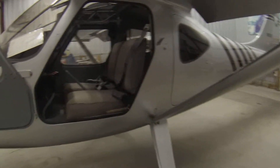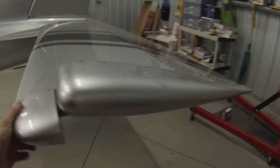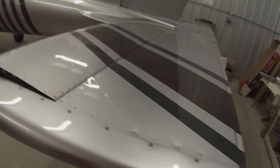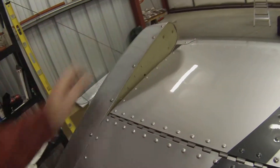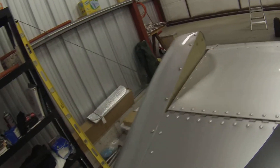The first step is to put down the flaps, and then I usually start back by the baggage door, just make sure everything looks good there, work my way down to the tail, make sure everything looks normal — no bird strikes or anything like that, no wrinkles in the skins on the tail, check all the fasteners on the fairings, also take a look at the inside edge of the ribs here, make sure there's no cracks where the counterweights are located. There can be some stresses there, but there are some doublers put in to stiffen that up after they saw cracks on some of the earlier planes.